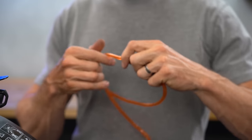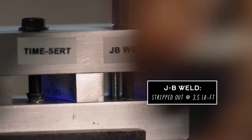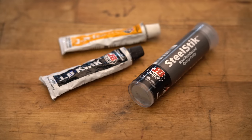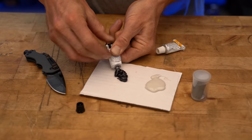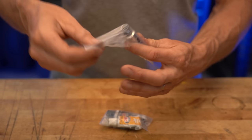I'm not concerned with carrying extra gas or oil, but I do want to be able to transfer gas into my tank or someone else's, and it's important to keep oil in your engine if you punch a hole in your crankcase. Packing six or more feet of quarter-inch hose will allow you to siphon fuel from another bike or even a car. As for patching catastrophic holes you've punched in your clutch cover or radiator, that's where JB Quick and JB Steel Stick — which is more of a putty — can save the day. I keep a few washers and coins handy to help span and reinforce especially large repairs. I'll cut the stick and squeeze out half of the tubes to reduce the quantity to what I'll need for one or two repair jobs. I also carry a small tube of RTV sealant, and I stick all these tubes in plastic bags just in case they leak or rupture.